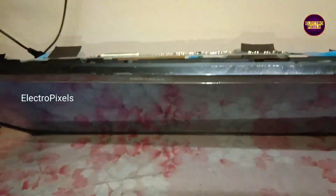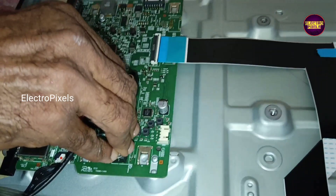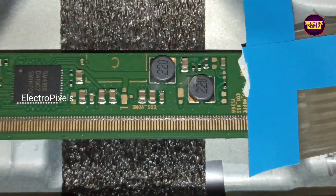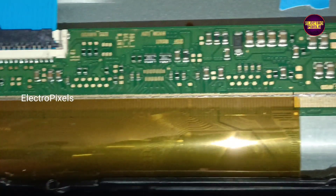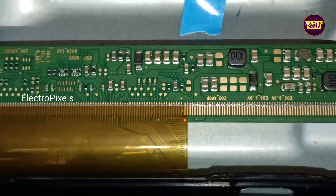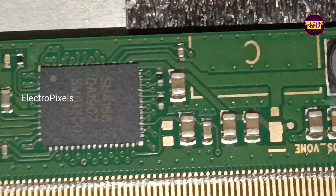While tapping on the screen you can see the backlight flashing, so this means that the backlight is okay. Actually this panel comes with the SM4186 DC-to-DC IC. Due to internal shorting in the gate signals, this DC-to-DC IC goes into protection mode, and because of that it doesn't generate any basic panel voltages like VGH, VGL, AVDD, etc. This is the reason for this blank screen issue.